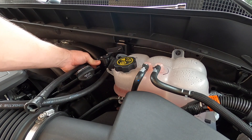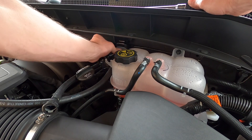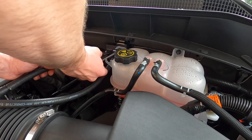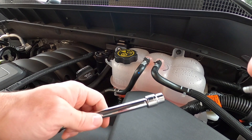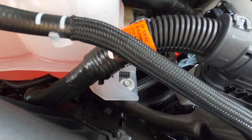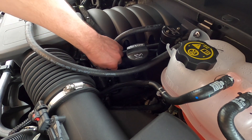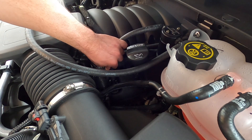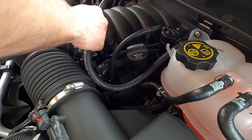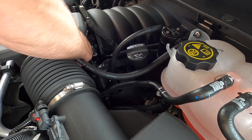Go ahead and get our mount hooked up. Put this one on in between, stick it on there, and it actually comes with a nut to put on here just to ensure it doesn't pop loose — 10mm. We're going to go ahead and throw it in our lower coolant bolt. Now we can go ahead and attach these guys — obviously your shorter one is going straight down. Listen for the audible click. That one's locked on. This guy's running underneath our intake, right here — listen for the click.